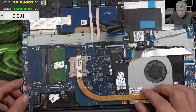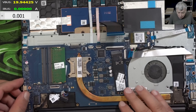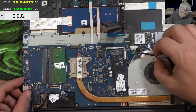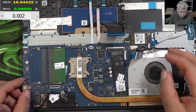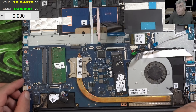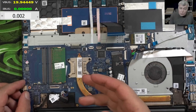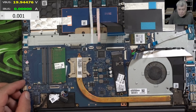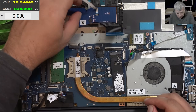I've had jobs where the board was not coming on at only 2.6V. Why? Because the logic level '1' is 3.3V but it has a range — it's not exactly 3.3V. The range can be from about 2V to 3.3V. Under 2V it's a logical zero.